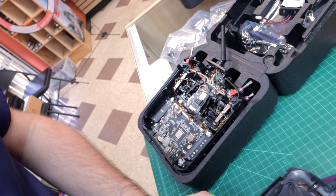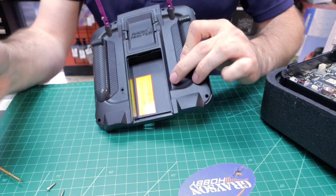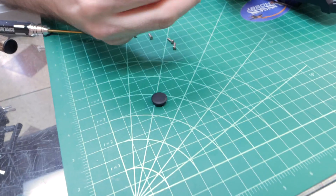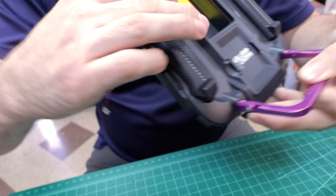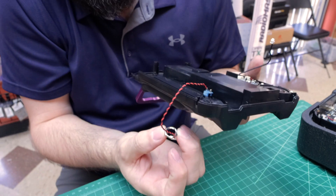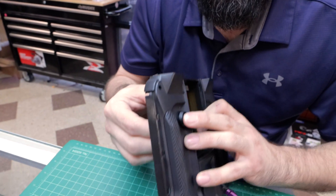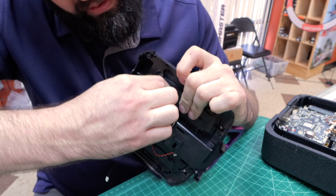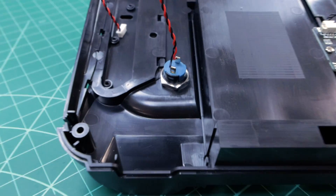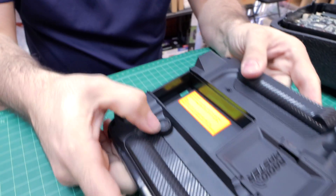This is essentially where we're going to be working now — we're going to install one of these buttons here. We're going to do the momentary. So you're just going to pop that out from the backside — that came out a lot quicker than I thought it would. We knocked out the little rubber plug. We took the nut off the back. The little rubber grommet is still on this side of the button. I'm just going to run the wire through to the backside. Now while holding it, run that back through and thread it on. If you push down on the button side, because it's got a rubber grommet, you can get it turned by hand pretty well to where you don't need to use any sort of wrench or pliers. That's on there. Now we have a button on the back.